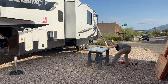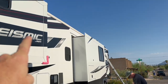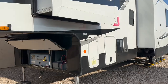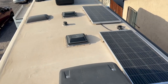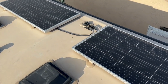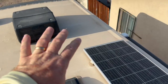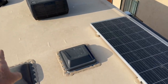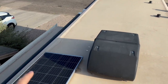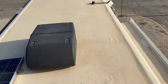You can see Todd busily getting after it on the solar panels. We've got seven of these that we're going to add to the two that are already on top of this toy hauler. Up on the roof, you can see our two Go Power 200-watt panels — we've already unplugged them. We're going to add two more panels up here, one there and one there, giving us a series of three, two more panels for another series of three, and then three panels here for the third series of three.